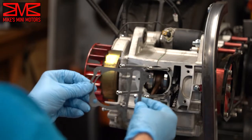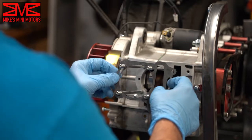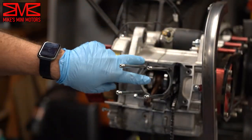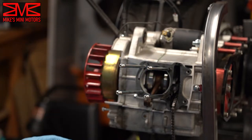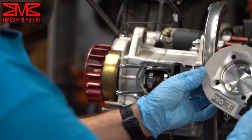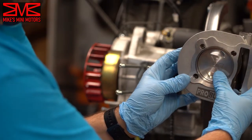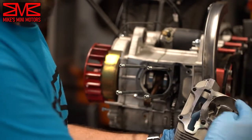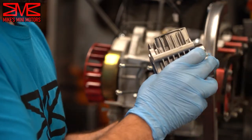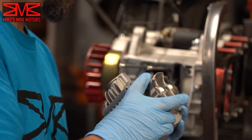All you've got to do is just slide it on. Also make sure you have your two dowel pins in place. One nice thing about buying this ProBuild kit from Matt is he already puts the piston rings on the piston and installs it into the cylinder. I took some oil and rubbed it around on the inside for lubrication, then I'll push it back slowly. You don't want it to pop out, otherwise you've got to check your rings.